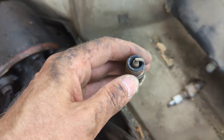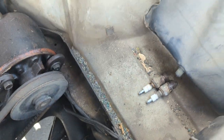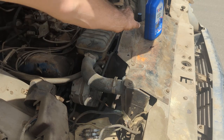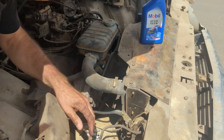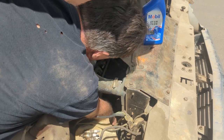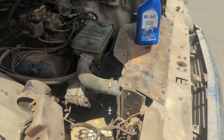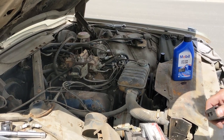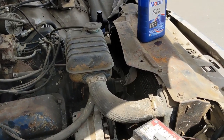So far the plugs are pretty much like this. I don't see any big problems with the cylinders, but we'll keep working. I've got some ATF in all the cylinders. I don't know how much you're going to be able to see of this, but I'm going to have the camera on. I'm going to start turning it over. I've got my 15-sixteenths wrench on her, and the fan is breaking away now. I'll get back to you when it's ready to crank with the starter. I've got some rags down by the manifold so it catches the transmission fluid. Let's go.